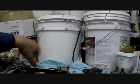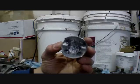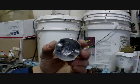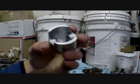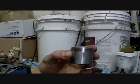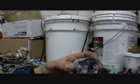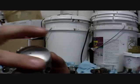Now, let's start with the cylinder. With the cylinder, how you port it, you want to make sure all unnecessary metal is removed. Now, I had a couple of unnecessary pieces of metal in here that I filed down and got rid of. What this does is it lightens up the piston so that it can go up and down a lot faster, producing higher RPM. With higher RPM and a lighter piston, it'll be easier for it to get to that high RPM, therefore improving acceleration.